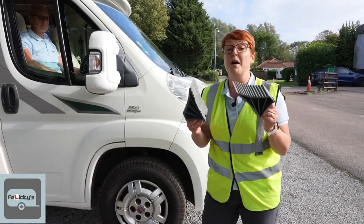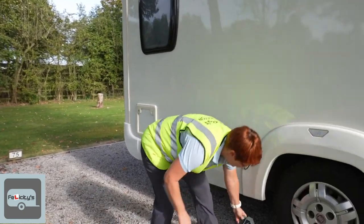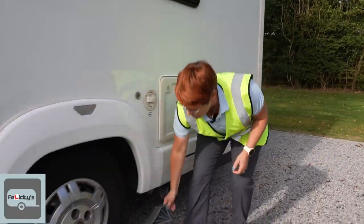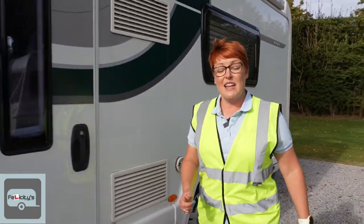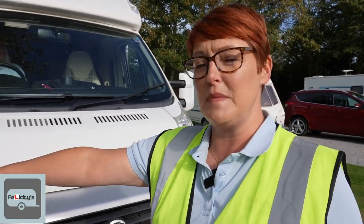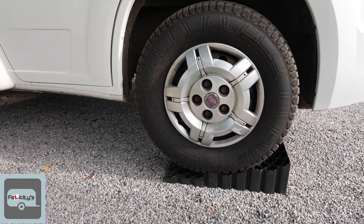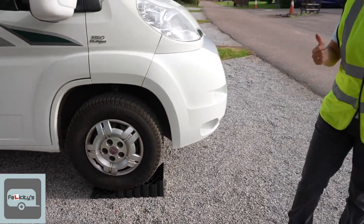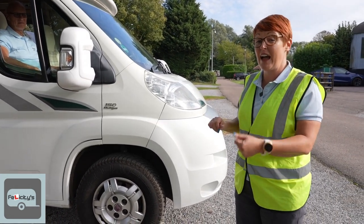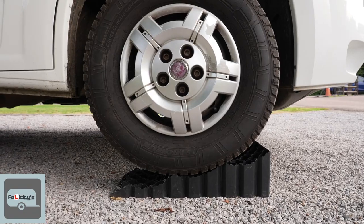You need a set of chocks to put behind the wheels you haven't leveled — that's the back for us. I'll come around the other side while Andy still has the brakes on. We're going to use the chock there. When Andy comes off the brake, you'll see minimal movement on the tyre, and we are level. The handbrake will only hold so much, so it's always going to rock a little — by using the chocks you're just protecting it. Once your chocks are in, you could actually take the handbrake off a couple of clicks because it's perfectly wedged on the chocks and up on the leveling ramps.